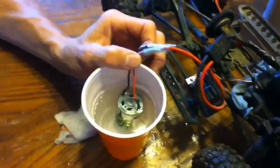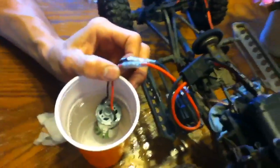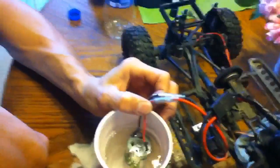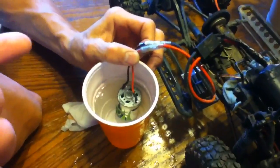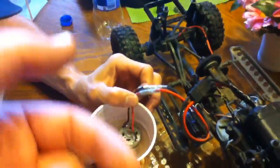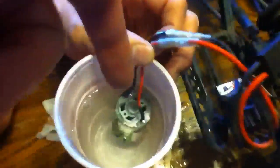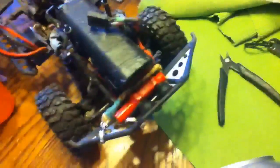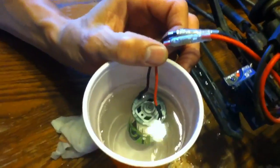And lastly, you're going to want an air compressor. That's what I recommend. After every run, I blow the motor completely out with an air compressor just so that the motor does not rust. Or you can get compressed air cans, which is cheaper, but we have a bunch of air compressors, so we use that. Just take the air compressor nozzle and spray all around it inside. Spin the motor over whenever you're doing it. That, again, prevents against rust and corrosion.